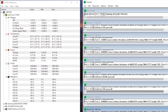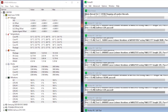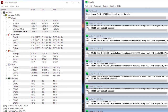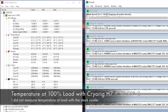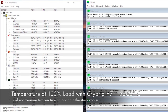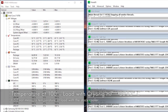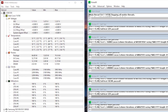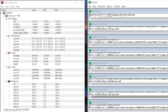I took this screenshot about an hour after I had started running the Prime95 stress test, and you can see average CPU temperatures of low to mid-50s with max temperatures of high 50s, around 60 degrees, which I think is pretty good. Another important thing to point out is this cooler is really quiet — in fact, under heavy load the CryoRig cooler is actually a little bit quieter than the stock cooler was when the computer was idle.